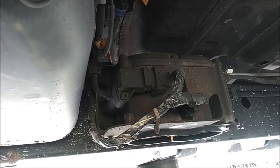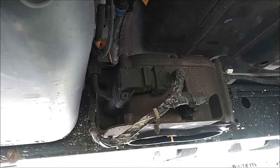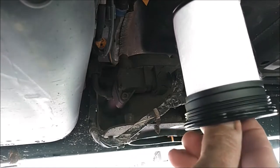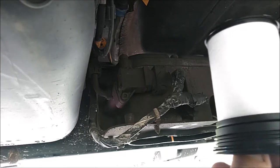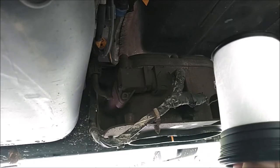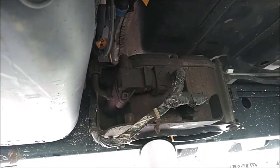Here's the factory filter — this is the first filter change for this truck, straight from the factory, and it's got a blue o-ring on it. The filter element is dark gray, and at 4% filter life it's definitely ready to be changed. Off camera, I took some automatic transmission fluid and rubbed it on the outside of the o-ring at the base of the filter cap, making sure not to get any ATF on the filter element itself. That's just a lubricant for the o-ring to make it easier to remove next time. You could also just use diesel fuel as a lubricant.